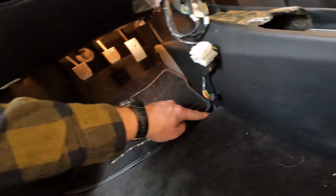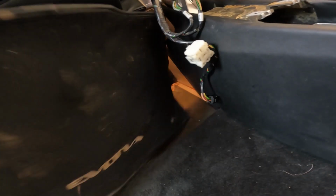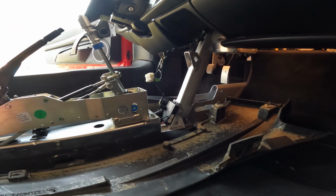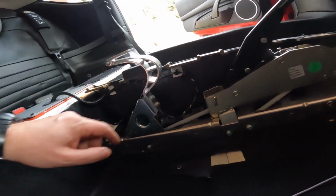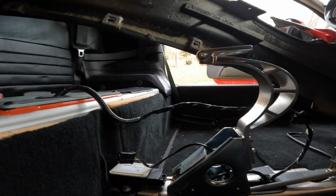Now, if you'll notice, it's kind of binding down here. Let's pull up the floor mat so I don't have to deal with that problem. There's a clip up there. On this side, start pulling gently, and then it'll just pop out. That one actually came out without the aid of the floor mat. A little easier on this one. For this wire, I'm just gonna clip it off here in the two zip ties. There, we get that trim piece out. There we go.